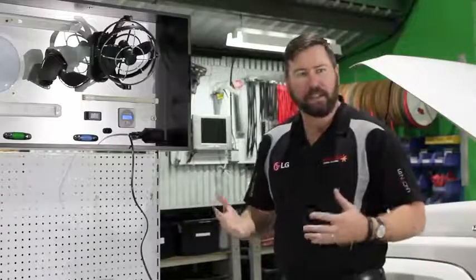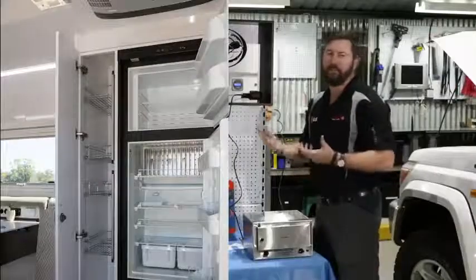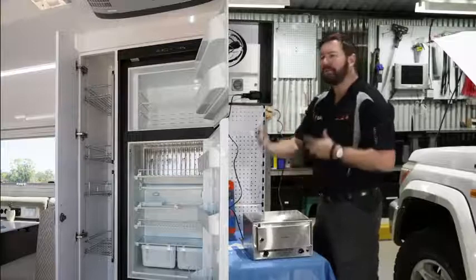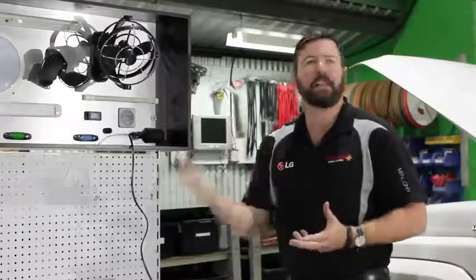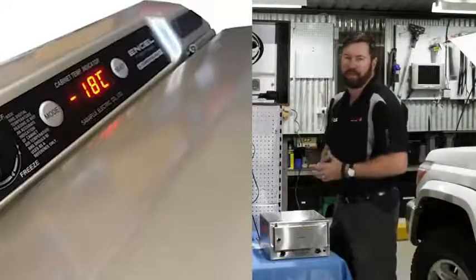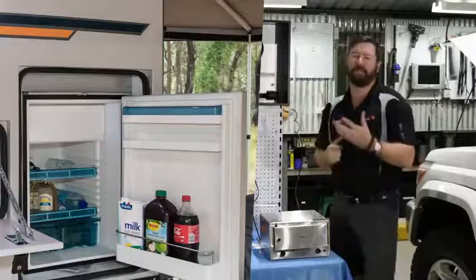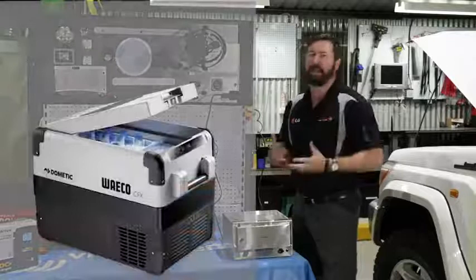Beyond lighting, one of the biggest things we need to power from our auxiliary batteries in our RVs is our fridge — our refrigeration. Determining the power draw from a fridge is a grey area. We need to know lots of different things about how you're using it: how big is the fridge, how many liters does it hold, and how cold do you run it. Our small 25 to 40 litre fridges are going to draw anywhere between 20 to 30 amp hours per day.